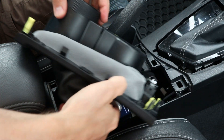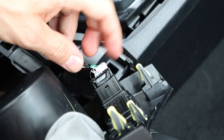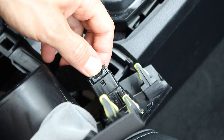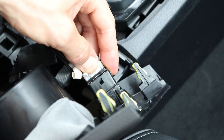There are some wires at the back — two wires underneath the cup holder. There's a black connector and a white connector. Make sure that the car is not turned on and the key is not in. Then you can disconnect them. On the black one, press the little tab down and pull it out. Same with the white one — there's a little tab, and pull it out.